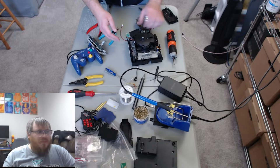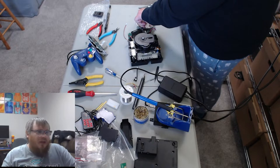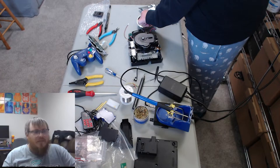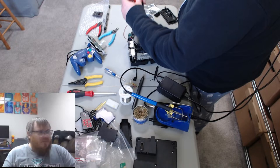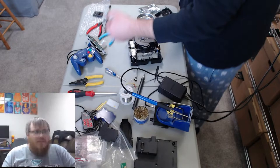Using a save game exploit is going to take longer to boot. The GC loader or the Pico boot are both valid options of getting it to boot directly into Swiss and then loading your games. I think most of the compatibility issues have been taken care of in Swiss, that audio streaming and whatnot works directly from the SD card slots.